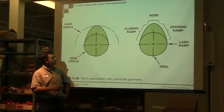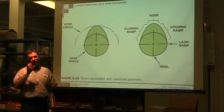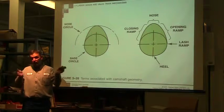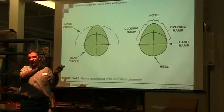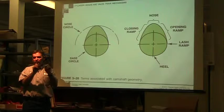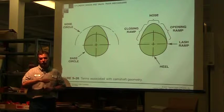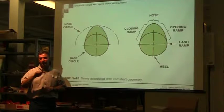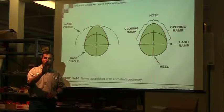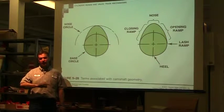I used to have a Honda Civic with a VTEC engine in it, and in the VTEC engine, the camshaft has a hydraulic cylinder, a little plunger, and as the engine oil got up to a certain temperature or pressure, it pushed the whole camshaft over. There was a double set of cam lobes, so as it moves over, the valves would be on a different lobe. On my car, if I just stepped on the accelerator, it would go until it hit 4,000 RPMs. At 4,000 RPMs, it would just sit you back in your seat. You could feel the difference when that camshaft pushed over and changed the dynamics. The RPMs would just, boom, hit 6,000 just like that.